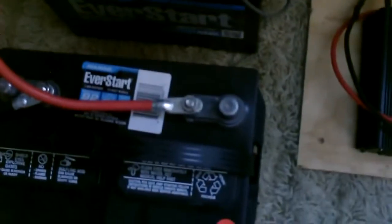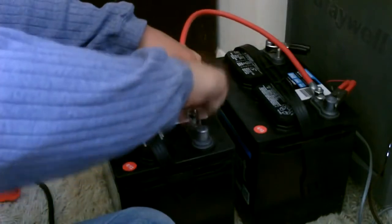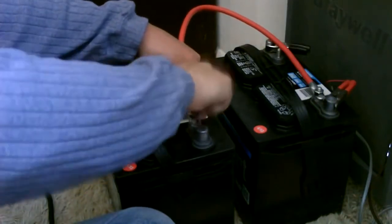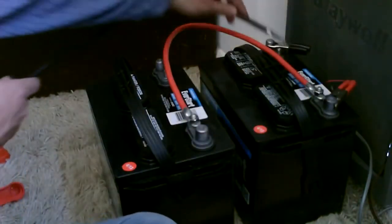As you want to expand this to two, three, or four batteries, just use some automotive cables and go from the positive terminal of one to positive of the other, and with the black wire, negative terminal to negative terminal of the other one — black to black.